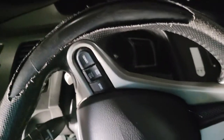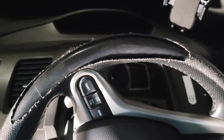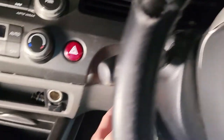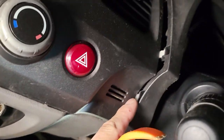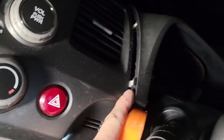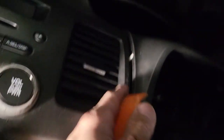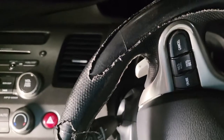The top panel is held to the dashboard by plastic clips. We want to start from the bottom here and pop it — you'll see the clip come up first, then on the side the clip comes up second. You might try to go a little further and lift it up a little bit, but don't be too aggressive, because over time the sun may damage the plastic structure and it can break more easily.